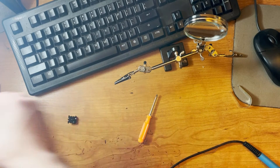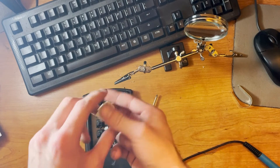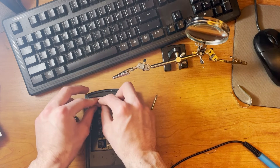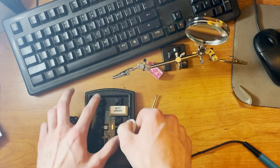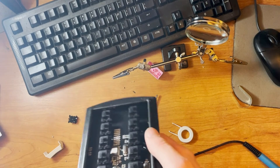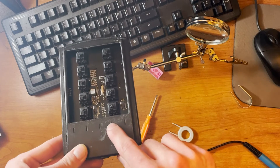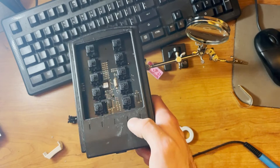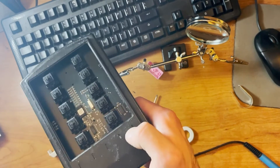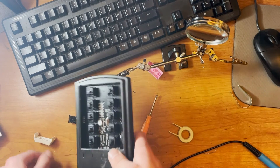You'll probably need the keycap remover tool to get the keys off the broken bump bar that you're replacing, but you don't really need it to put them on — you can just make sure you put it in the middle hole. I probably should have put the keycaps on the ones I just fixed and shown them off. There you go. So when you finish doing this, you want to take it to the restaurant and test it. When you plug it in, this light will light up. And every time you press a button, if it's functioning, that light will go from green to red. The only case that it might not work — I found that there are some circuit boards that will light up but won't do anything on the KVS controllers. Those you might just want to throw away and cut your losses on that one, especially if you spent time fixing it.